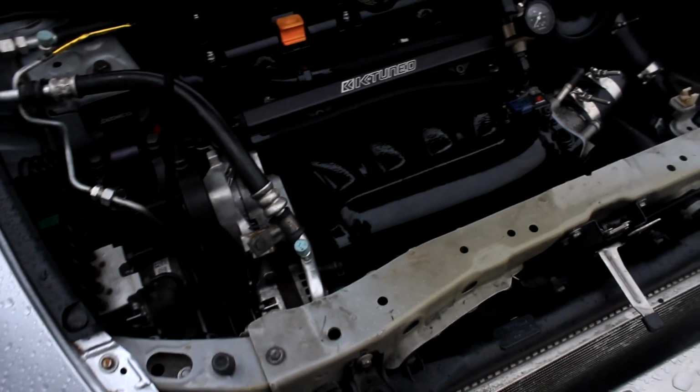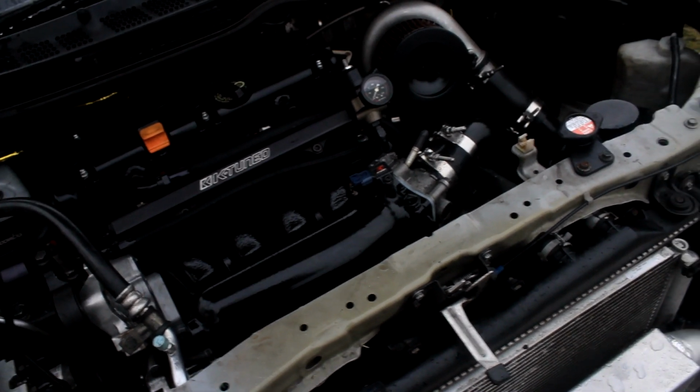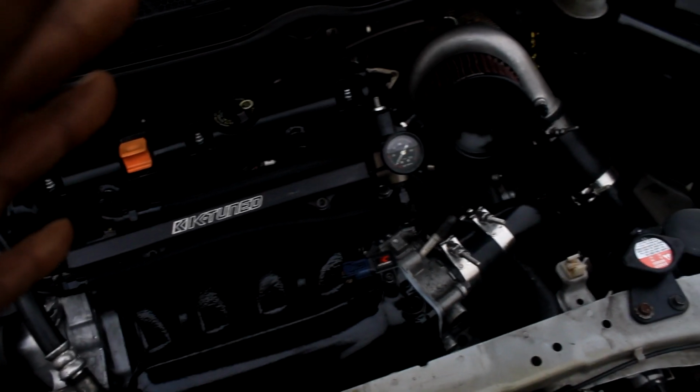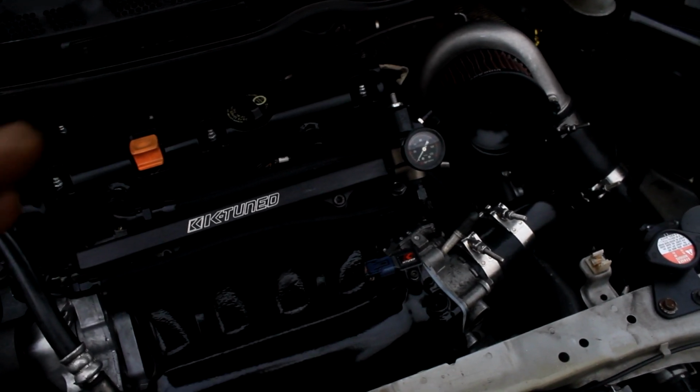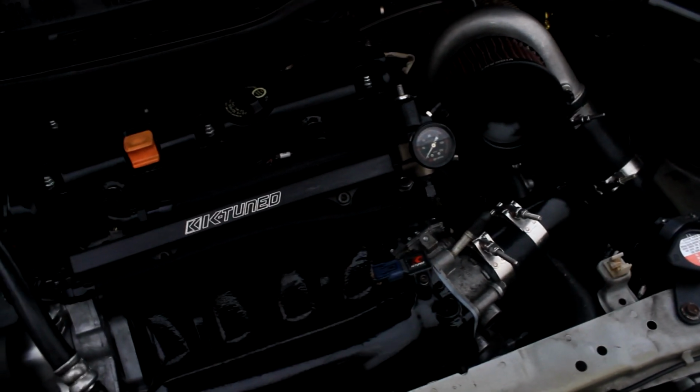So I was like, okay, something might be loose or whatever. It was vibrating so bad that the O2 sensor fuse kept blowing, because it's not touching the chassis, but enough vibration will cause that sensor to short on the chassis. So I actually insulated it better this time. And I noticed my transmission mount nut was gone. So I was like, okay, maybe that's my problem.